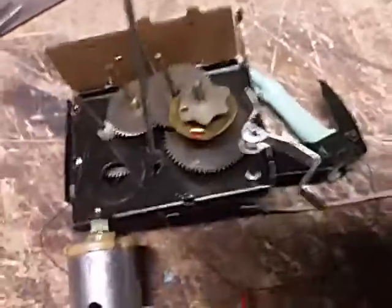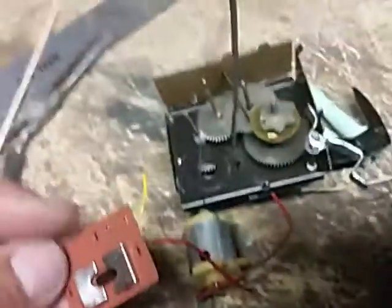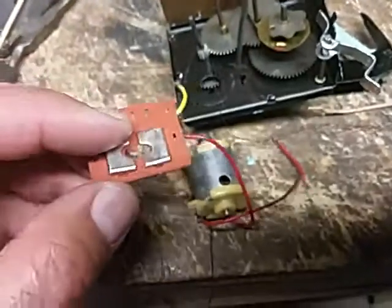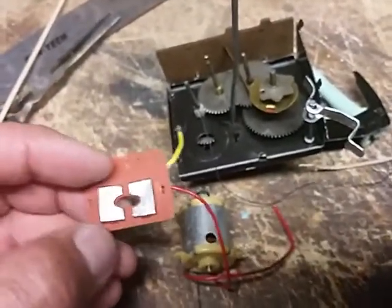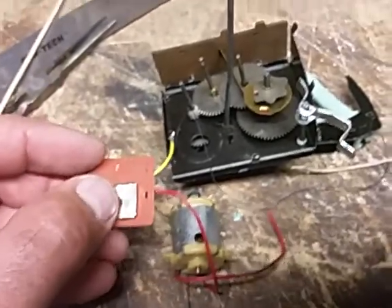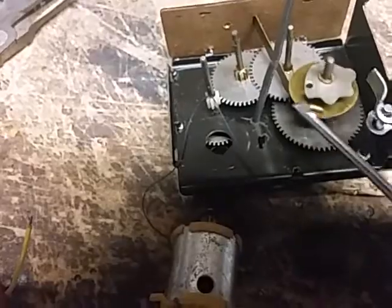So then the next cycle, when you're putting a coin — it's stuck to the motor. The initial contact is actually just a ground continuity. When you place a coin there, it closes the circuit, gets the motor running, and then once it does that, this brass wheel takes over.